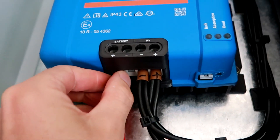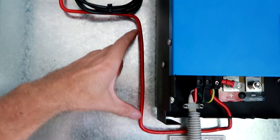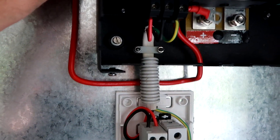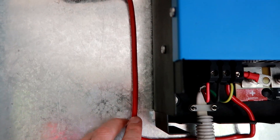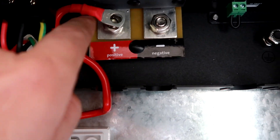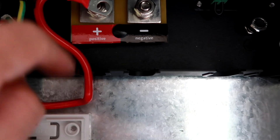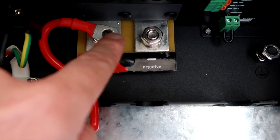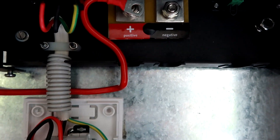We've got the positive battery terminal connected now. I can put a circuit breaker in this area later on if you tell me it's absolutely necessary, but if it's just a cosmetic or peace-of-mind thing, I'm unsure. Here's our negative cable just waiting for the battery terminal - always have the battery terminal connected to the inverter terminal directly, and this one goes on top. I'll do the negative now.